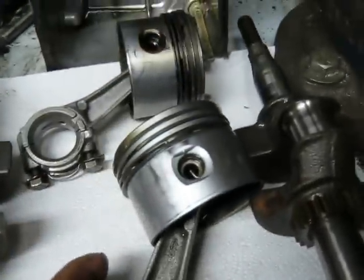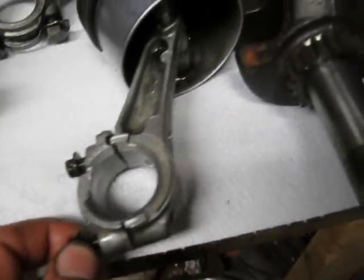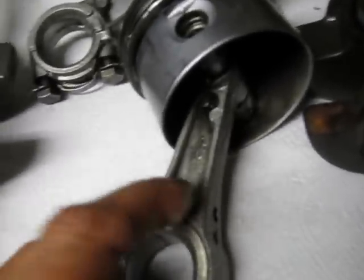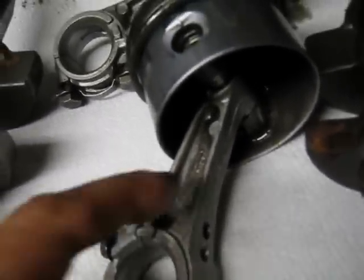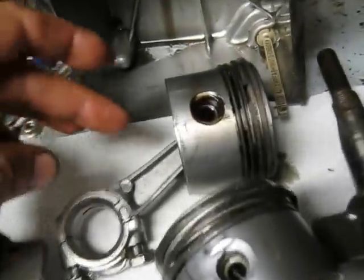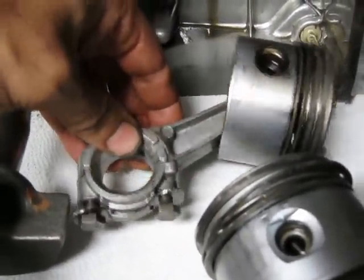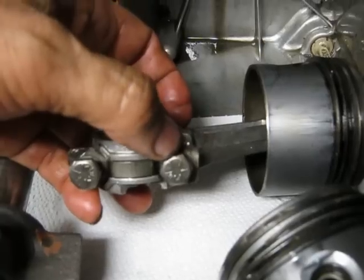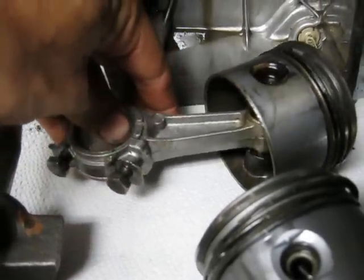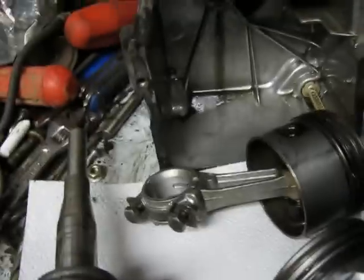Here's the piston out of it. It uses the small 5/16 head socket cap screws. The connecting rod has almost like a sandblasted finish — it's a rough finish. Here's a comparison from the 1980s: the connecting rod is shiny. This one's also got lock tabs and a 7/16 head bolt — lock tabs you bend over. That could even be from the 70s, because they did switch to one that doesn't use the lock tab intermediate.